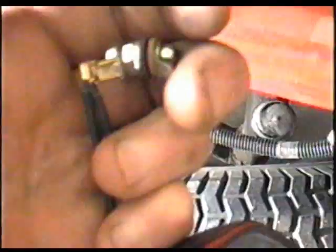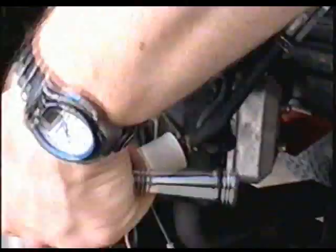To remove this little diode, you have to remove the 5/16 bolt here. At this point you can disconnect both wires. If the bolt turns with the nut, it's a 5/16 nut on the other side as well. Be careful when the nut comes off that you don't drop it inside the engine there — just grab it real good when it's coming off. You can also disconnect the wire, and now you've got your diode out.